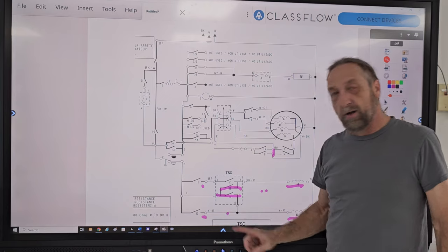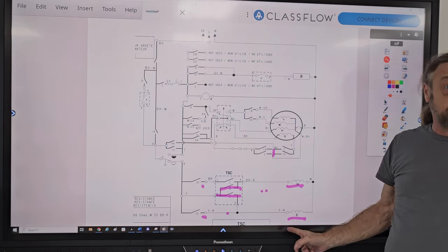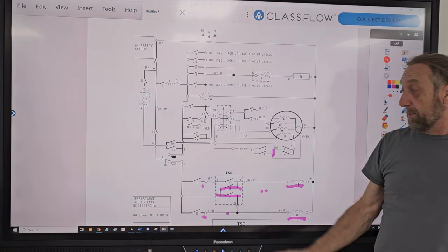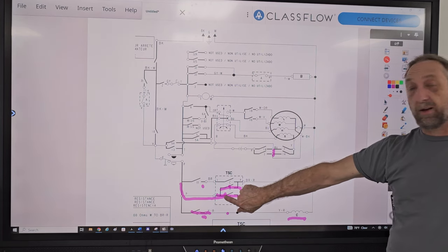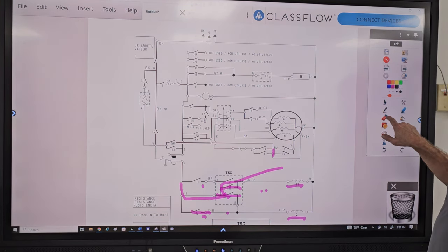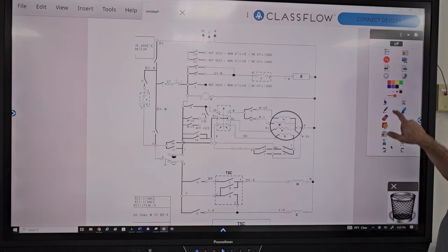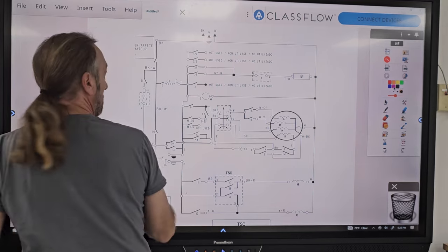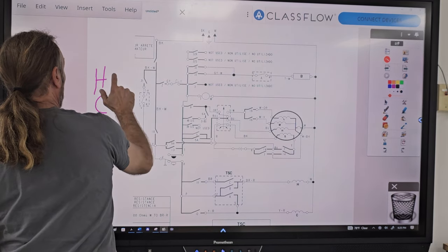But the cold water at number 12 was to at least ensure that we're going to get cold water during the final cycle, no matter what the customer selects here, okay? But if I select this, even if 12 closes, this is always going to get power. So it's going to force here. But if a customer chose hot, cold, just by looking at this diagram, what switches will be closed if a customer put hot wash, hot wash, cold rinse?